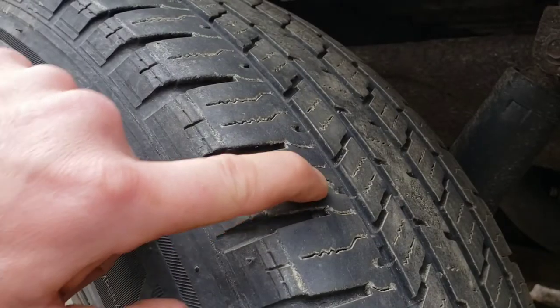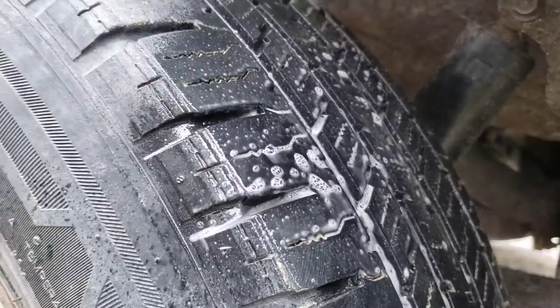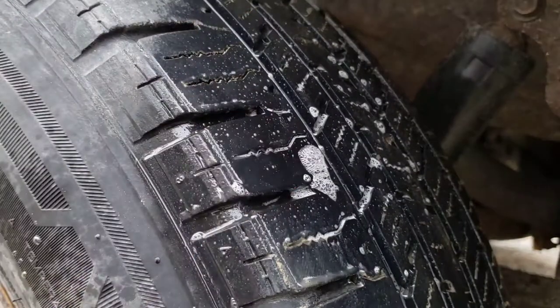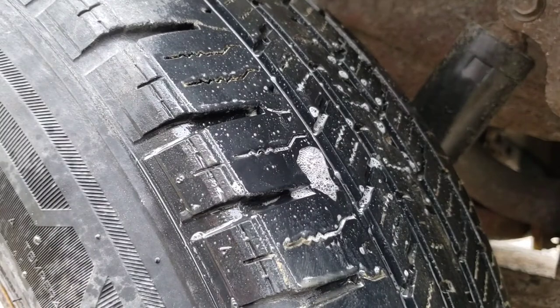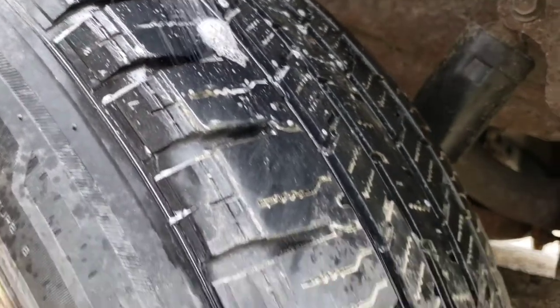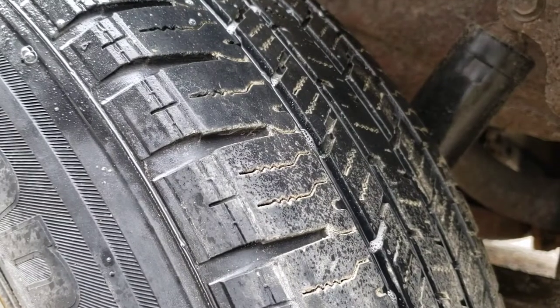I have a broken off nail right here. Spray it with our soap and water — you can see the air bubbles starting to come up, so we know we're leaking air there. If you don't have anything you can find in the tire, go ahead and just rotate your tire around and keep spraying to see if any air bubbles are created. That's how you can find your leak.